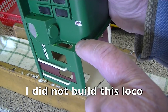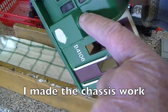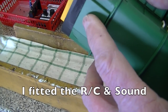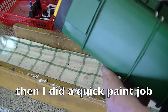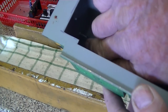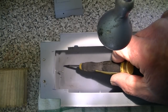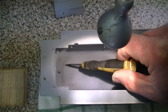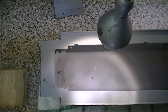The cracks around here I think will be a simple fill job with body filler. I'm going to have to make a new one for here. I think I'll tackle the hardest one first, which is going to be this dent. This whole panel has been pushed inwards with an almighty bang to have dented this very strong piece of metal. You can see inside I'm going to have to bang here. Looking inside the bonnet there's a big ridge just there and here is a screw — I'm going to have to cut that screw off, and then with a piece of wood bop down on this ridge and hope that the whole darn thing doesn't fall to pieces.